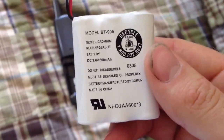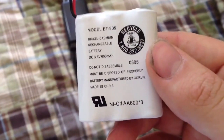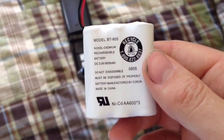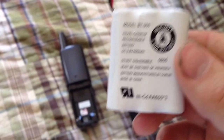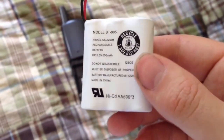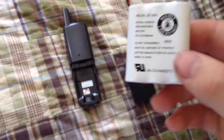The reason why it's not charging is because this is a 3.6 volt battery, and the way a telephone charger works is it charges the battery when it recognizes a certain level of voltage. If the battery voltage drops too low, which on an older battery like this is entirely possible, it won't charge because it won't even recognize the battery.